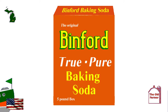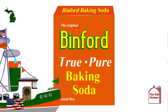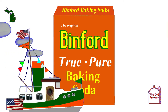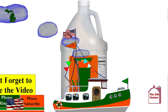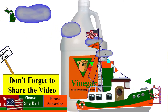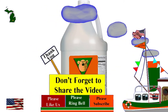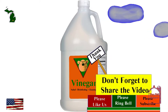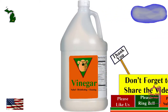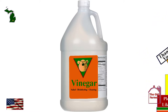Run on the heaviest cycle. And if all the baking soda has been cleared out, add some more if the sides of your dishwasher have not been cleaned. You can also use a cup or two of vinegar, but first drain all the water and run a rinse cycle. You don't want to mix the vinegar with baking soda. You could have some fizzing to contend with, similar to the old volcano science experiments from former school years.